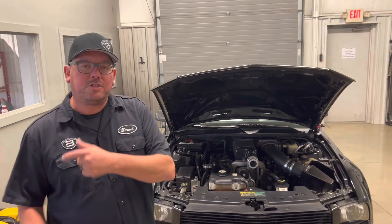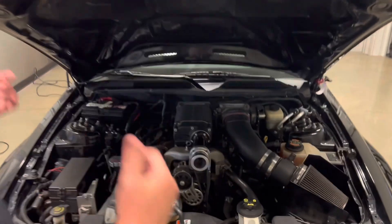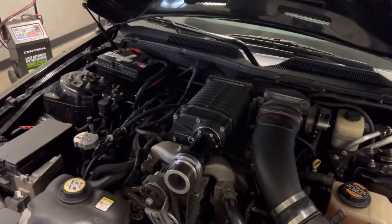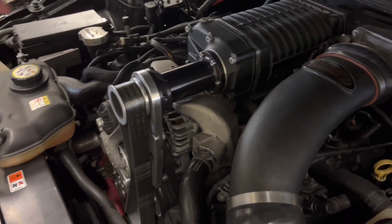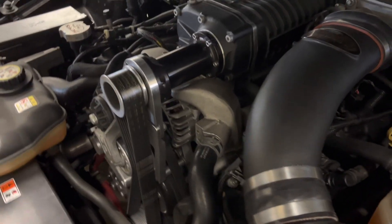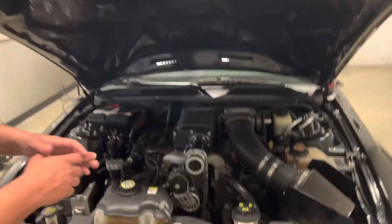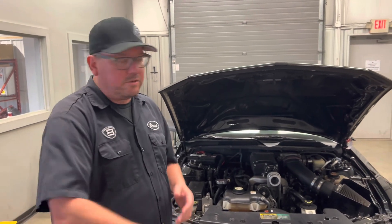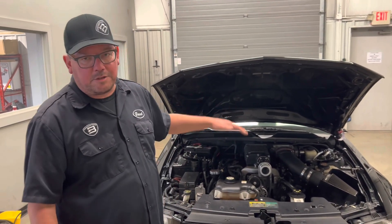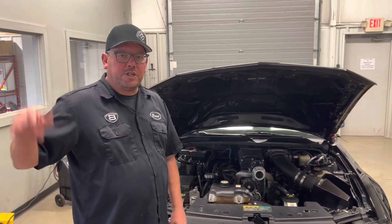You can look at the Detroit Rocker camshafts and the E-Force supercharger. This Whipple right here is only about seven to eight pounds of boost and has a very strange pulley setup — I think this is a system Steve made back in the day. We installed colder spark plugs with the intercooled Whipple supercharger kit, the Detroit Rocker camshafts, a set of shorty headers, and a catted H-pipe to fix the melted cat problem this car had when the client bought it.